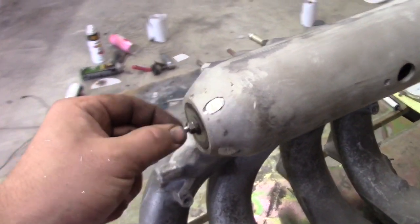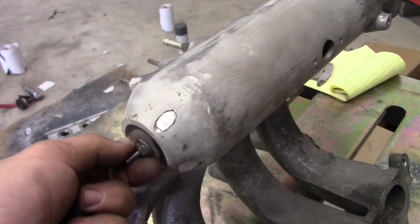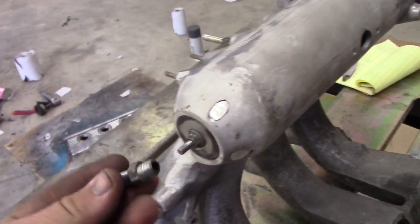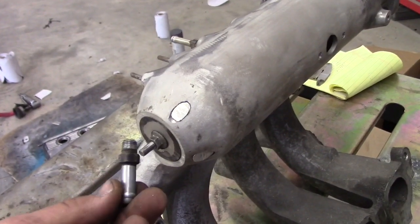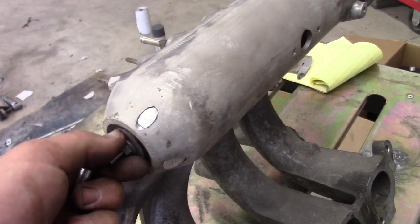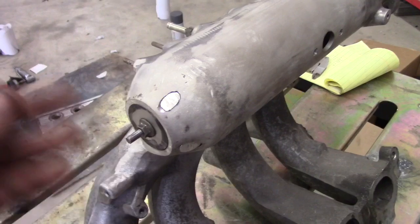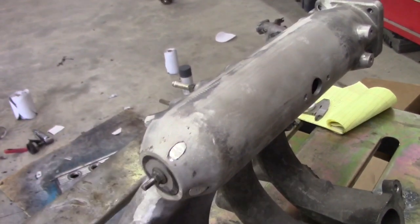Just to note, this bolt here that I use to secure this piece actually does have a purpose. After everything's TIG welded in, I need to tap it for this, I believe it's 1/8 BSPT or whatever, the British type thread, for my vacuum for my brakes.